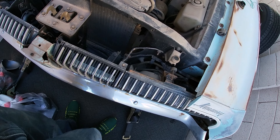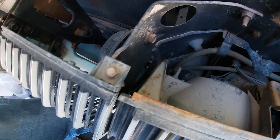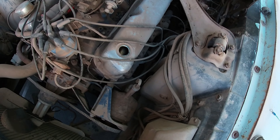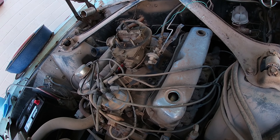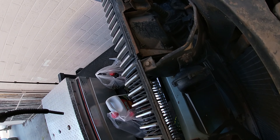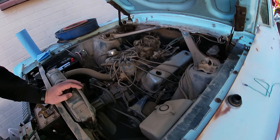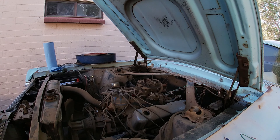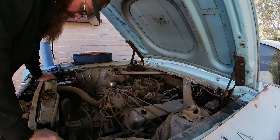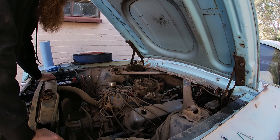These Cougars are also known for their pop-up headlight deal here. The problem is all in there and right here and all of that — those are all vacuum lines. It operates both vacuum pot motors down there, and those are just giant vacuum leaks waiting to happen. I see I'm missing my fan shroud, but that's okay because we're replacing it with an aluminum one anyway.